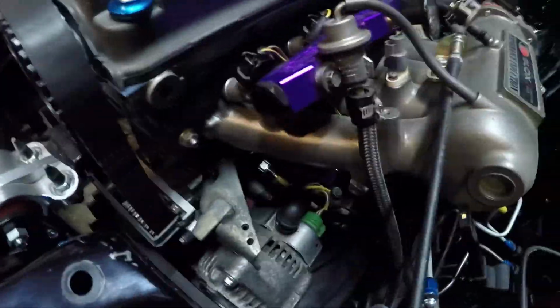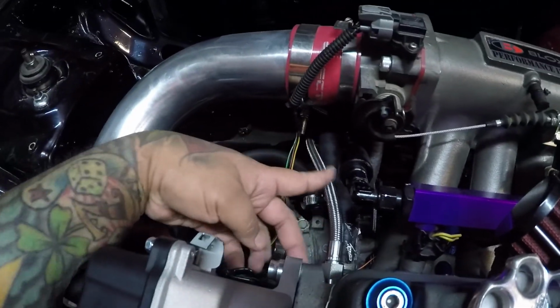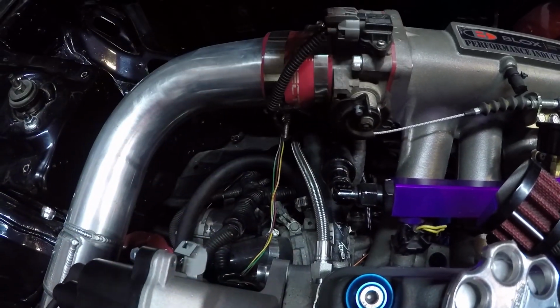I don't know if you can see it, but you can kind of see it. It's just the oil pressure switch now. It threaded in fine. The oil filter's on. Everything's pretty much buttoned up. The line is on. It's coming in the long way, pretty much. It loops this way and then comes down this way, and I hate that. So it's kind of a crutch for now, just until I have time to go make a new line.